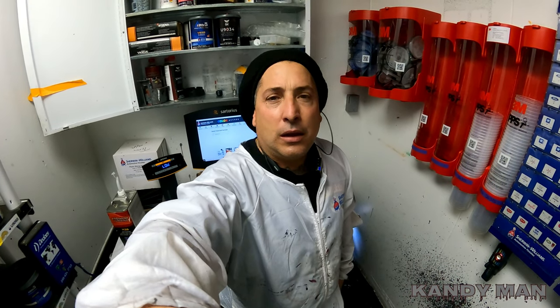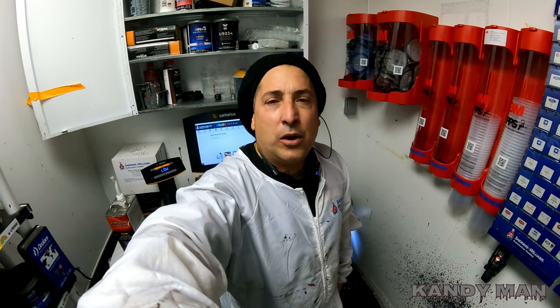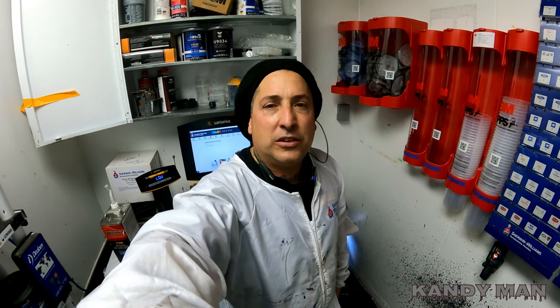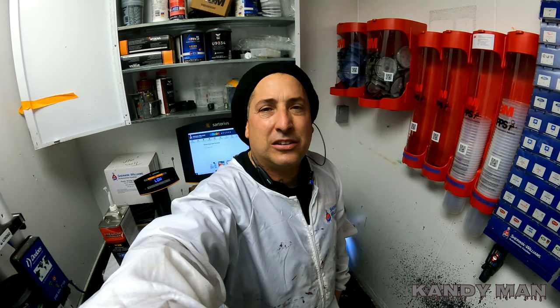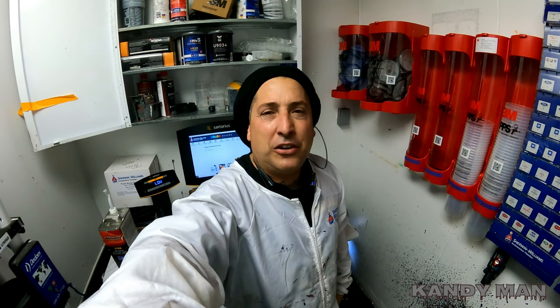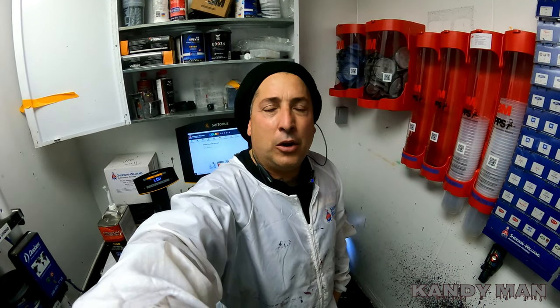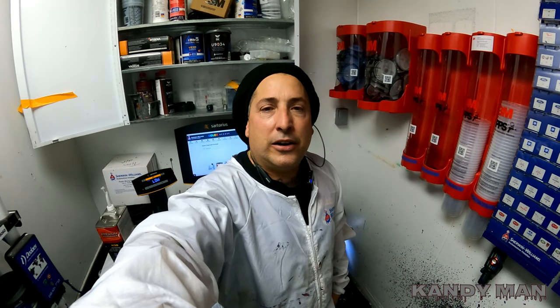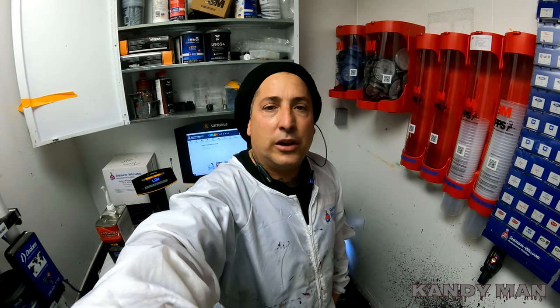So I'm going to show you today what I noticed when I got that C2 cap. When I turn the pressure down, because it breaks up and is putting out a bigger droplet, I can turn the pressure down on the gun, with the CC200 being a medium solids clear, and it actually lays out slicker turning the air pressure down than turning it up. And I know a lot of guys think that it's the opposite, but when you have a quick clear, it doesn't flow out like a slow clear would.